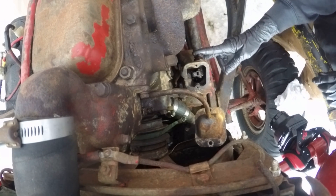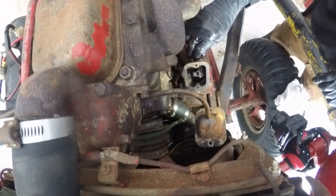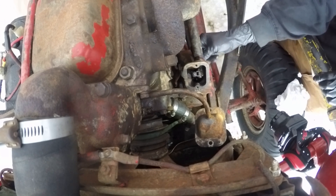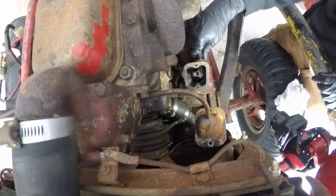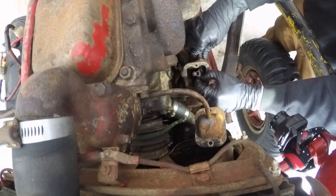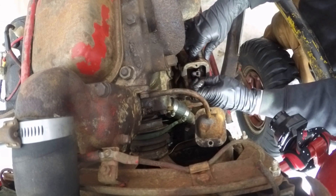There are two screws on the back of this governor shaft and they have slotted holes. If you need to, just loosen the two flat-head screws at the back and you can move this up and down until that pin moves freely. You can see here if it's too tight and doesn't slide — relax it a little bit and there it is.